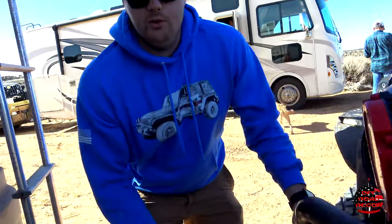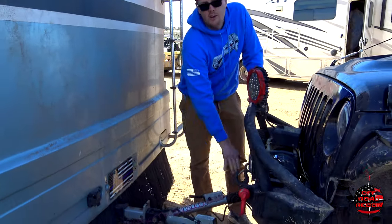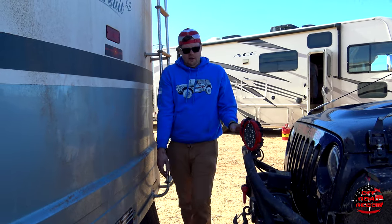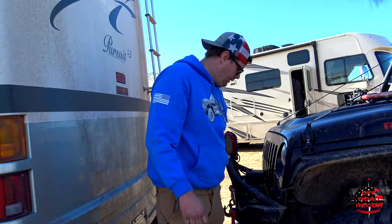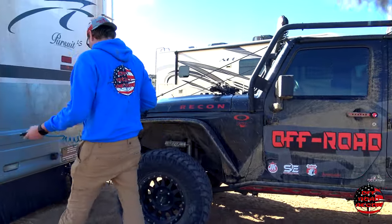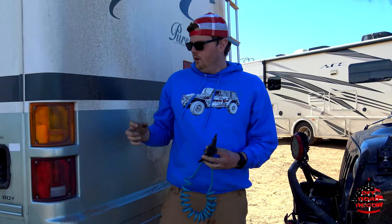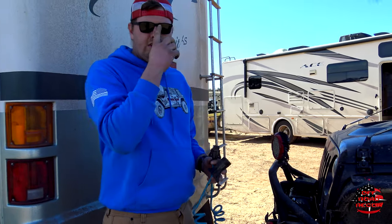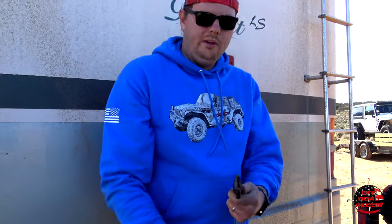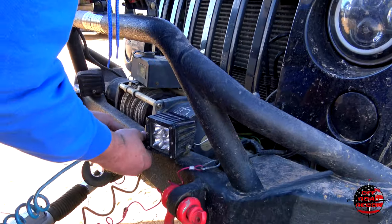Something else that's important is when you're towing, you want your point of tow from your hitch to the rig that you're pulling behind to be pretty straight, and as you can see we're pretty close to that. This wire here is for your brake lights — it will let your rig lights control the brake lights and taillights on your Jeep. It just plugs into your normal brake spot, and then the other end is a four-pin connector which plugs into the Hopkins connector, which I will link in the description.